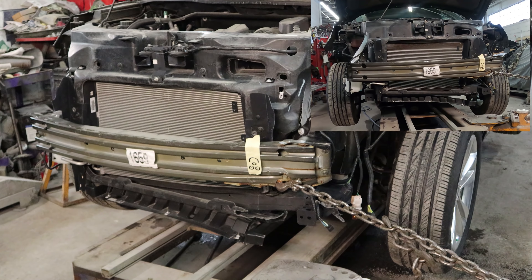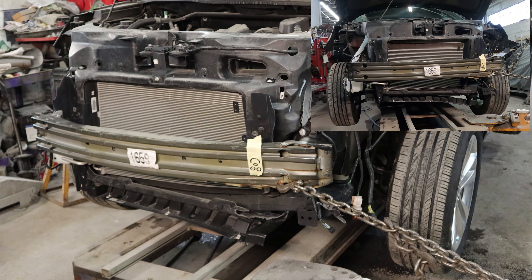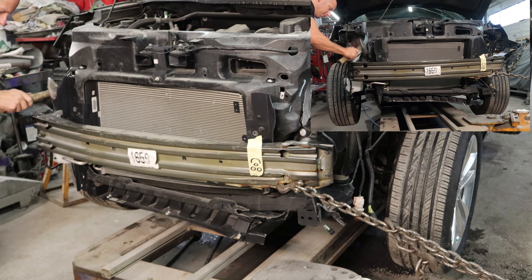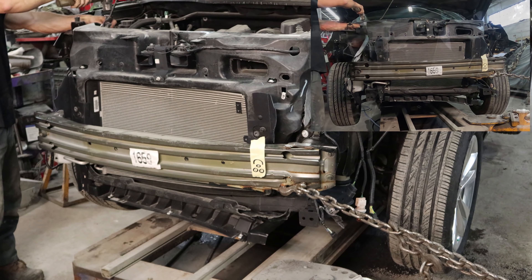These frame rails are high strength steel, so they can't be repaired. I did figure out I'm putting a new one in anyway, so no loss. A little stress relieving getting our apron back to where it should be — it ripped a couple of the welds out when I pushed it over. It didn't kink anywhere so it was still within tolerance to be straightened.